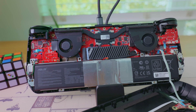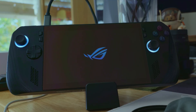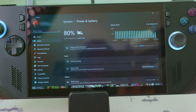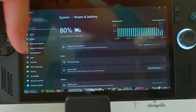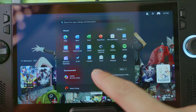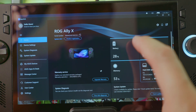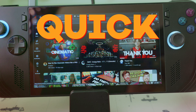Now let's talk about battery. To keep your battery nice and healthy, you can protect it through the MyASUS app. The ROG Ally X does have pass-through so that when it hits 100%, the battery stops getting the charge. But you don't want to keep your battery at 100% all the time or you're going to degrade the battery. This is definitely for people that have their handheld constantly charging. Once you have this enabled, it will only charge up to 80%, giving that 20% wiggle room to help preserve your battery health. To get this going, head to the MyASUS app, then battery care mode.